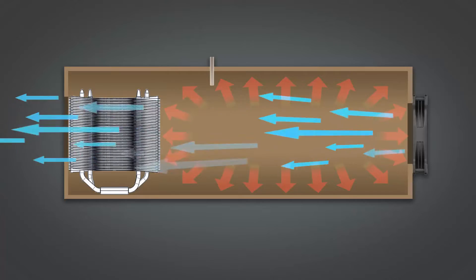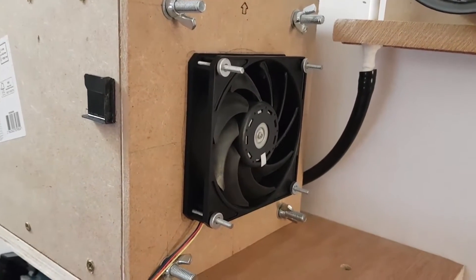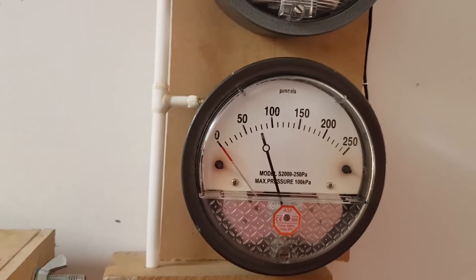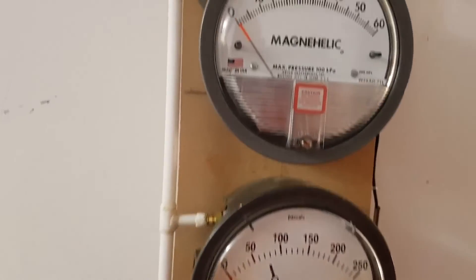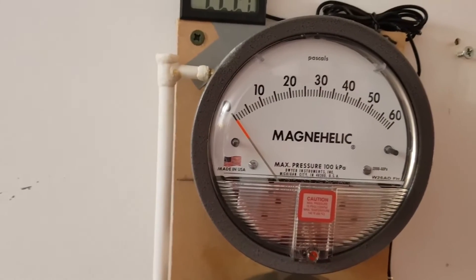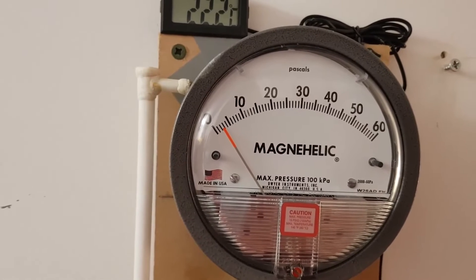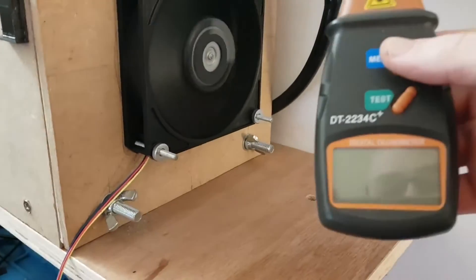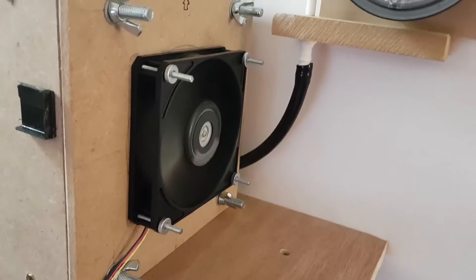I've put a Gentle Typhoon on this end of the chamber, set to run at 1000 RPM. Just to show that the gauges are both accurately set to zero — the lower resolution gauge I don't really use, except for much more powerful fans, typically server fans. Let's have a look at what happens to this gauge when I power the fan on at 1000 RPM. We're sitting at two and a half Pascals, kind of nudging three. The speed is just a little over 1000 RPM, which is generally what people will run a cooling fan at in a PC case.